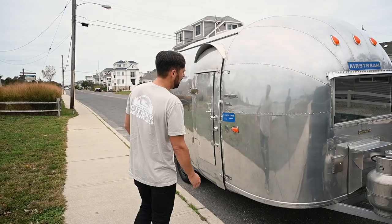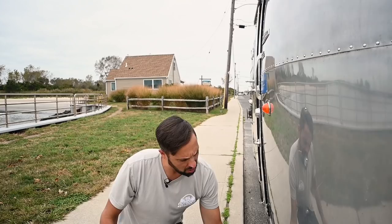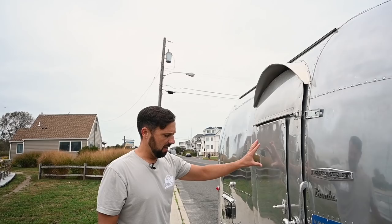The exterior width is 7 feet wide and the exterior height is 8 feet 6 inches. When Airstream built these trailers back then, they would stretch-form some of the panels and buck-rivet all the panels together to get a nice tight seal all the way around. Then they would wrap the whole underbelly with aluminum, with insulation below, so it can withstand some cold-weather camping.